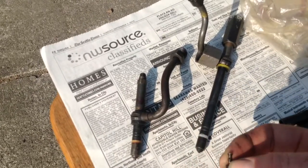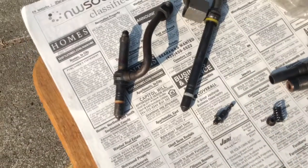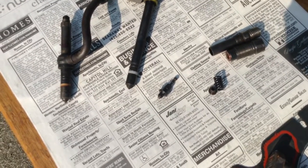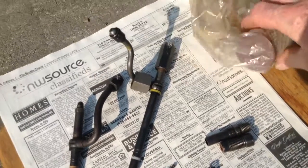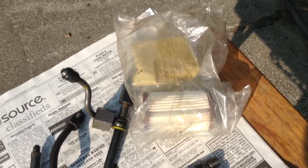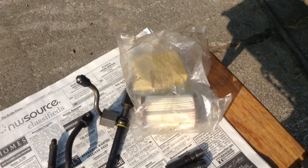Here is the little tiny micro-injector that comes out of this engine. These can be lapped in — they don't make new ones anymore. You take your Dremel and put some lapping compound on them, or maybe rubbing compound for your car, and you can polish those in. It'll probably work pretty good for a little while; it's a temporary fix. This is the filter that goes in that Raycor — way too small for these old diesels or any kind of V8 diesel. This is terrible to have installed; they'll plug up in no time flat if anything's wrong with the fuel. That's really only good for a Yanmar single-cylinder diesel in a boat — maybe.